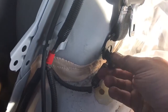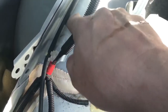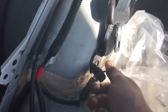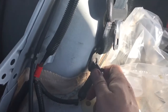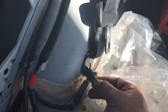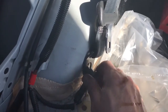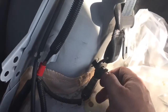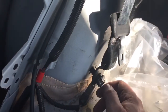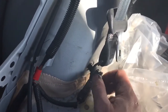These are the biggest problem I've encountered so far. The bottom seat lock bolts at the back actually go out into the wheel arch, so the bottom end of them is completely corroded. I got this one out but it took a lot of time and effort. It comes out at a funny angle and I slipped on the socket - I didn't round it, thankfully. I'd suggest getting behind them - which I'm going to do for the other side - and applying WD-40, leaving it to soak on the end of the threads. I kept having to back it out and run it in again to clean the threads as I went. I'll just leave the other one soaking in WD-40.